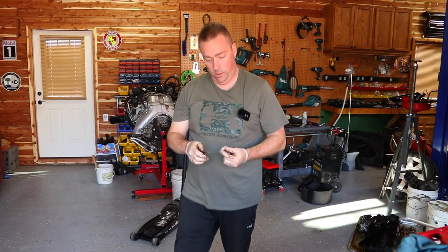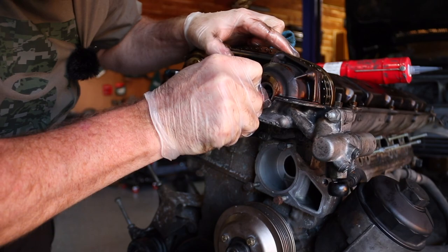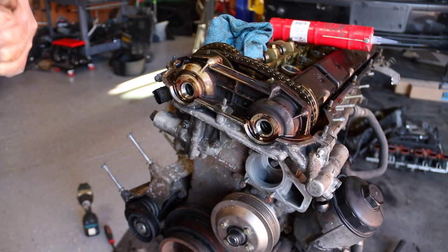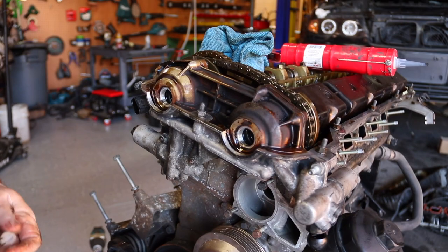We're gonna pop these in. We have a small pair of needle-nose pliers with a bent tip. For whatever reason, that works the best. So there again, I'm gonna get a little bit of oil here. Put on that ring. I'm not super impressed with these kits that give you the little pop-in pieces extra, because if they're aftermarket, it seems like they don't fit very good.